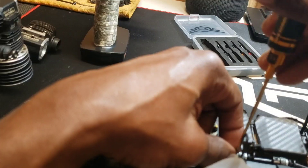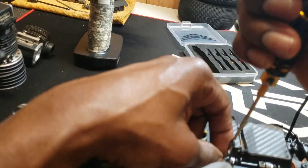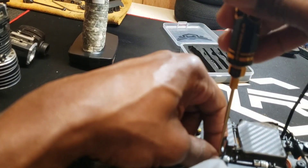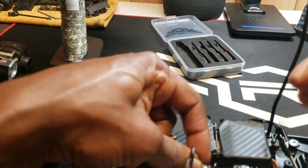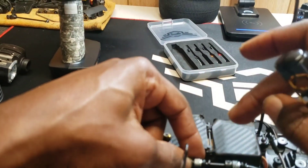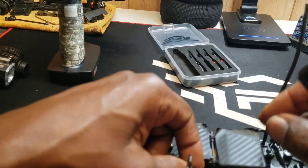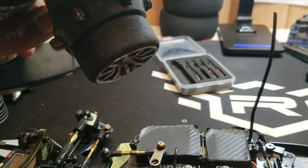This is just a little extra TTR team tip. It will just help us have more consistent brakes. And then if we need more braking, you just twist this part here — put tension on the ball right here — just like that. It puts more tension on the brakes. See how that looks, this part moving back. If you need more brake than that, then you can go into your radio and adjust it out too.